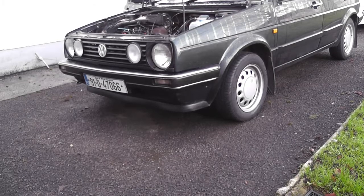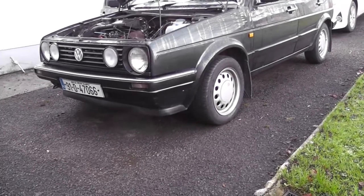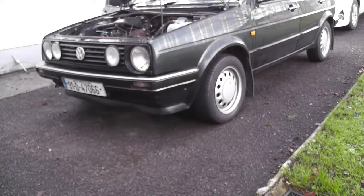But on an older car, what I like to do is use something like a piece of suspension, such as the lower wishbone mount or subframe mount or something like that, which is a nice solid point at which to jack. It just means sliding the jack in underneath a little bit more and seeing what looks solid and what doesn't, and don't jack it on the bottom of the gearbox or the engine or something like that. Common sense prevails here, and safety above all else. So if you're working underneath the car, use axle stands. They're not expensive and it could save your life.